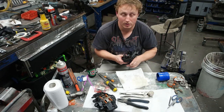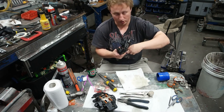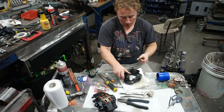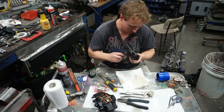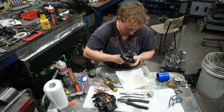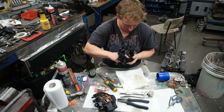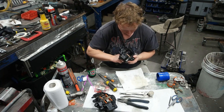Okay, so there's not much on there, just hitting it with the paper a little bit, we'll just ensure there's no high spots to catch and sort of reduce the braking performance. I mean, there's some little marks I can see. Not too bad, but still a good idea. So give it a little bit of a hone with the 1200.